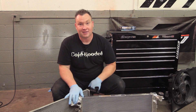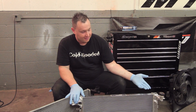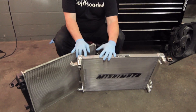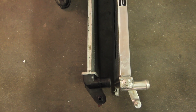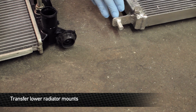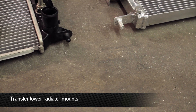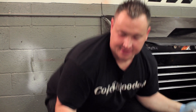With both radiators out and side by side, the difference is clear. The Mishimoto is clearly better in cooling — the core itself is about three times as thick as the stock core. Not only that, there's no plastic on the Mishimoto unit and coupled with a lifetime warranty, that pretty much guarantees you'll never have an issue with this. Before installing the Mishimoto radiator into the Genesis, you need to transfer the lower radiator mounting pegs from the OE rad over to the Mishimoto. Now that the bottom mounting pegs are on, we're ready to put this guy in the car.